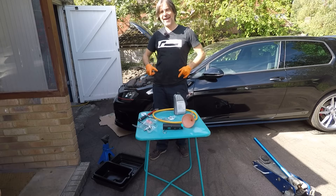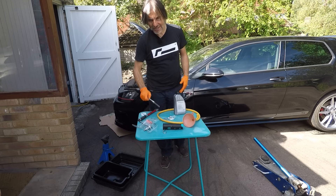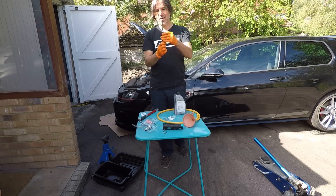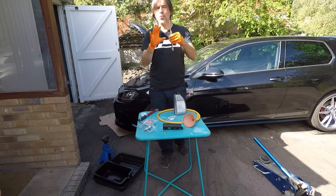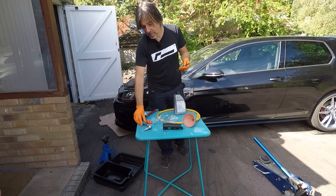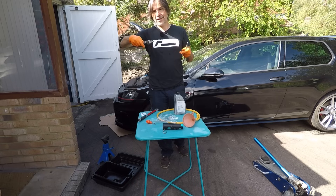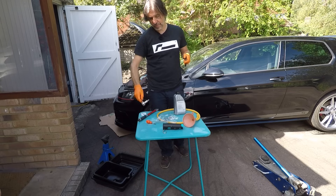Let's look at the tools and parts you need for this job. First you need an 8mm Allen key, because both the drain plug and fill plug are 8mm. The drain is approached from underneath and it's quite tricky due to the subframe location, so I've been using a ball-headed Allen key which allows me to go in at an angle. The torque isn't that high so that's fine. For the filler plug, which is on the side of the gearbox at the back of the engine, you can go in normally — just a normal 8mm Allen key bit on a ratchet.